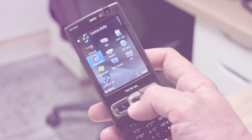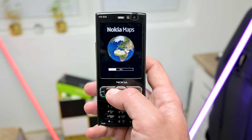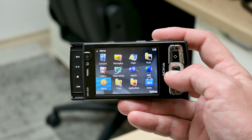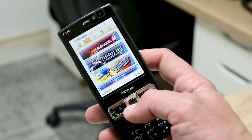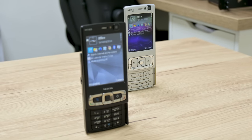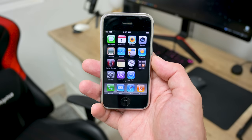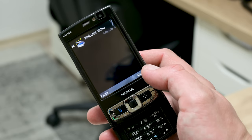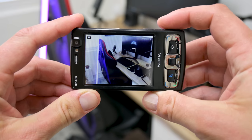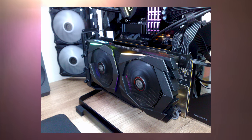A few words about the phone: the Nokia N95 8GB was released back in October 2007. With 8GB of memory, a 2.8-inch display, a 5-megapixel camera, Wi-Fi, Symbian operating system, dual-arm CPU, and many other features, this smartphone was a really big deal. But also, the N95 was the last of the line — 2007 was the year the first iPhone was released and the game started changing. The N95 was very ahead of anyone in terms of specs, abilities, and functionality. The camera was amazing, and these are actual photos captured using this N95 — very respectable, even after so many years.